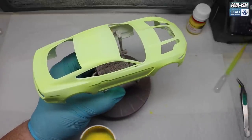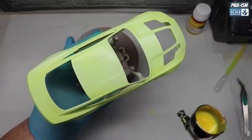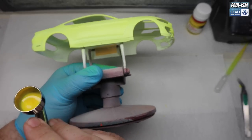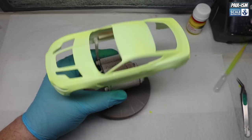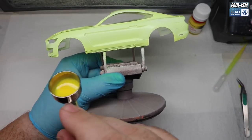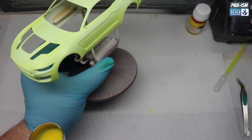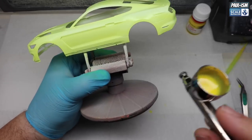And as you can see on this coat, the colour's really starting to build now. It's beautiful paint. Doesn't need high pressure. You could go lower than 18. You could probably go down to as low as 12. But it sprays absolutely beautiful. Really does go down really well. And it's the perfect colour. In my opinion, it's absolutely spot on for this.